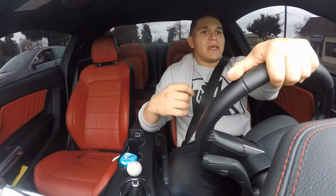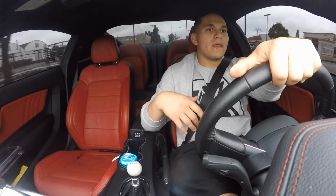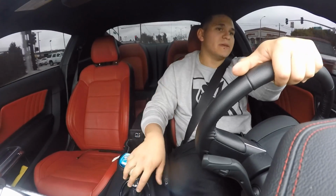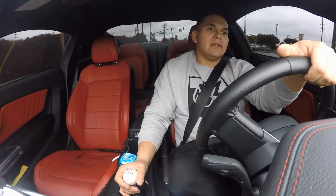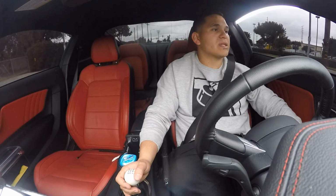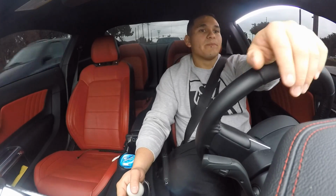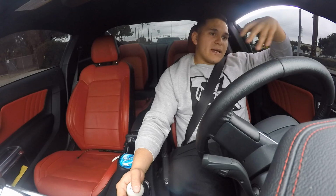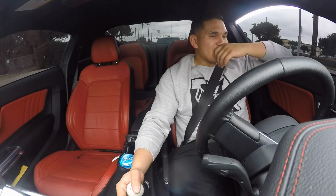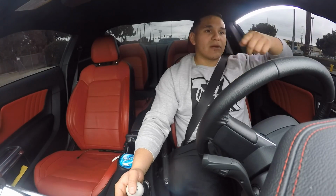One of them sent me a link to a Ford diagram of how to adjust the rear. There is actually a little bit of adjustment in, I think, the upper control arm. You're able to loosen it and adjust it very slightly, enough, I think, to get my alignment correct. So I called those guys back up and sent them that information. The manager there told me, yes, go ahead, bring it in, we'll get it done for you. I went today, and they didn't have time, so I made an appointment for Monday. I'm going to take it in on Monday.